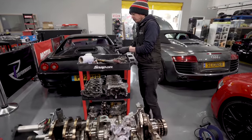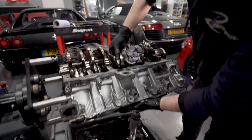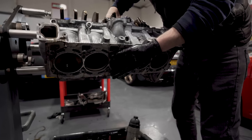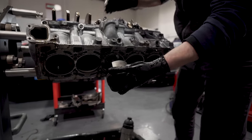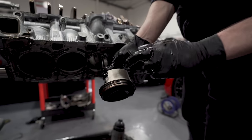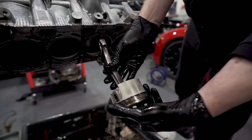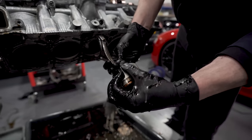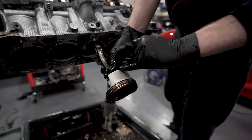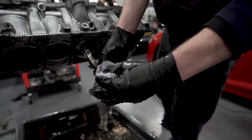So, two bolts. Cap, and then in theory you should be able to push this straight out the bottom. Right, straight away piston looks mint. Yeah, there's a little particle score there. Yep. Right, so I'll flip it over and again looks mint. No dull pad. Yeah, a couple of brushes, but like we see some where that middle square is completely worn out.